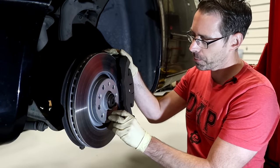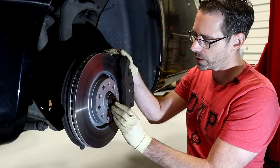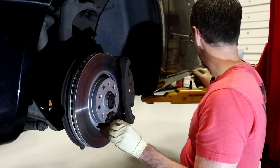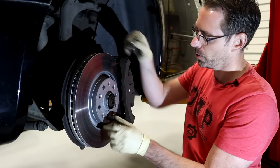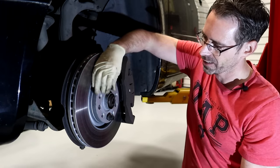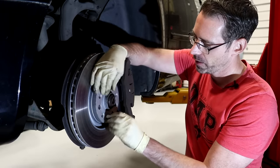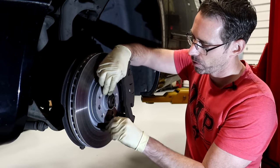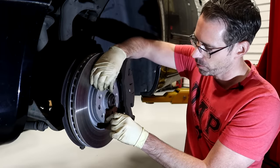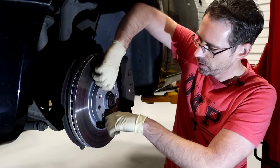So now we're just gonna put some wheel bolts in these holes, and I'm gonna snug these down. The reason why is we're gonna use this brake rotor to break this axle bolt loose. The set screw for the rotor right there is the only thing that holds this on, and it's questionable whether that's gonna be capable of actually holding the torque that we need. So we're just gonna snug these up and then we'll come back with our stuff to break this loose.